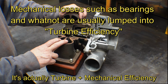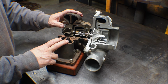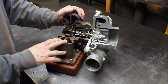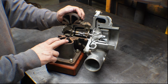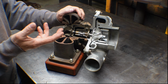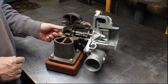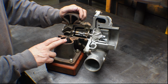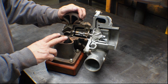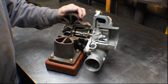But if you run it on an engine, when you measure the pressure, it's measuring the bulk pressure. It's not measuring the pulsation pressure. And if you run this on an actual engine, using that as an input, you'll get like 105 or 103 or 100, plus 100% efficiency usually, or very close to 100%, because it's utilizing the pulse energy. This split housing gives you an advantage in turbine efficiency by using the pulse energy. But maybe we'll get back to that.